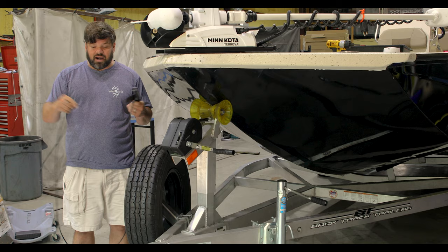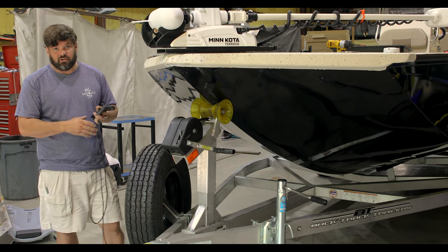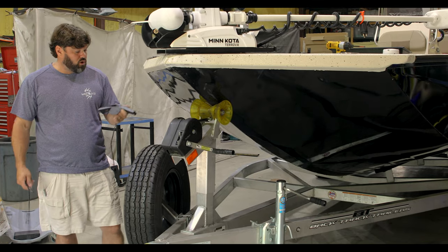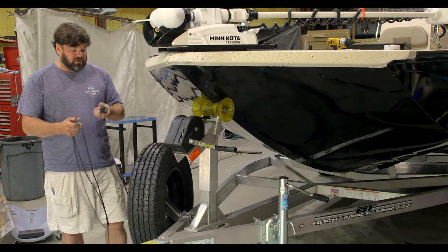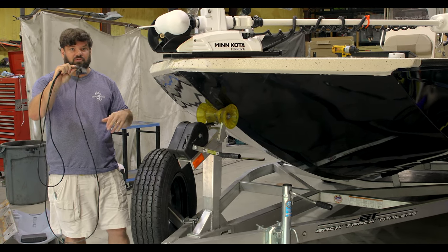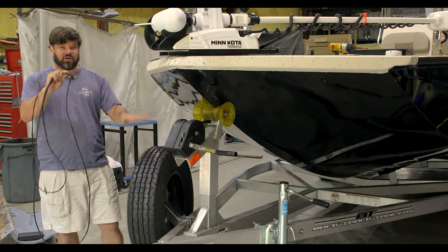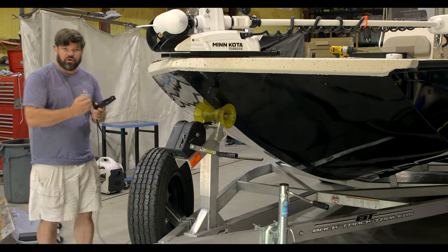It's going to come with all the wire needed and the quick connect to tie this into your factory harness or one of your factory tail lights. This system can be installed on the back facing forward and it's going to shine and illuminate everything to the sides. A very good place we found is right here on the center beam of the trailer, and the good thing about this bracket is it drops the lights down to below the frame on your trailer, so the lights won't be hitting other parts of your frame and being blocked.